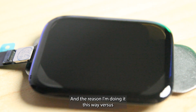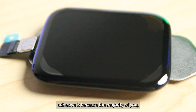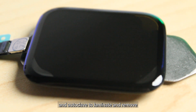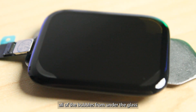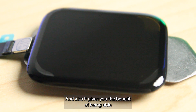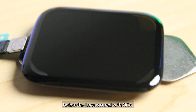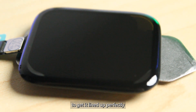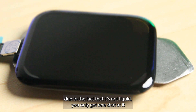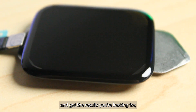The reason I'm doing it this way versus using OCA — the optical clear adhesive — is because the majority of you watching this video probably do not have a laminator and autoclave to laminate and remove all the bubbles from under the glass, as that's quite the investment versus the UV light and LOCA. It also gives you the benefit of being able to align the display perfectly before the LOCA is cured. With OCA, you basically have one shot to get it lined up, where with LOCA you have plenty of time to align the display.